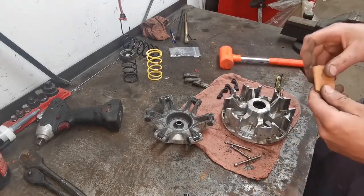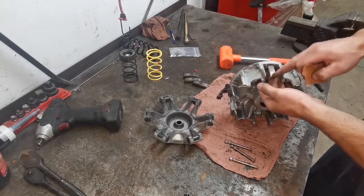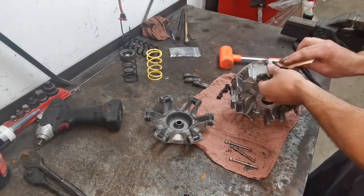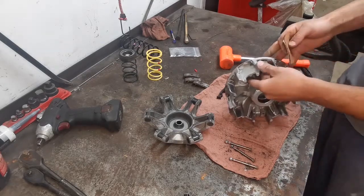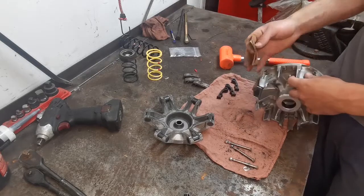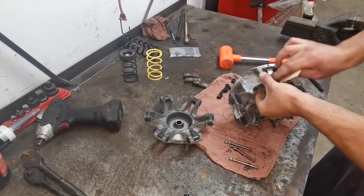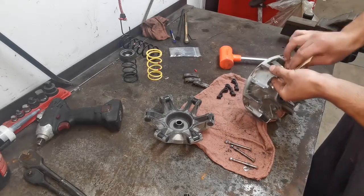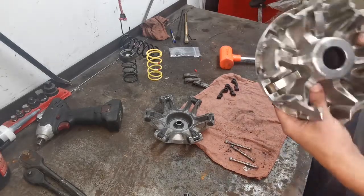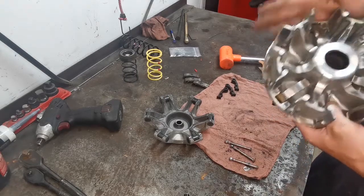you're going to get some very light sandpaper or some emery cloth, and you're going to give these contacts, this piece here, and where the buttons slide, a very light scuffing. The reason being is you don't want them to start forming grooves and gouges, so it's best to help keep things floating. Okay, so clean these 3 up. Just a little bit. You don't have to go nuts. And then go around and hit these slides. 1, 2, 3, 4, 5, 6, 7, 8, 9, 10, 11, 12. Okay? Go ahead and do that.